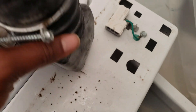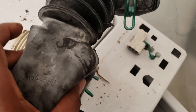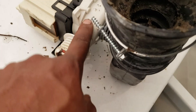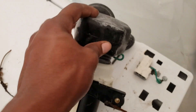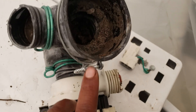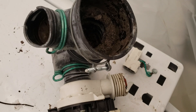What I'm going to have to do is clean this out. There's a coin trap inside here. It's a little hard plastic filter that catches coins and different lint and debris. That's clogged up and it's preventing drainage. This is where it's connected to the tub — water goes down, flows through here, and pushes out through the drain. So what we're going to do is clean this out by pressing the coin trap up — kind of push it up with your finger. I want you to not just clean this out and then spend your time putting it back together, because you might find out that your fan blade is damaged. Sometimes things pass through and hit that blade, so I'm going to show you how to test that also.